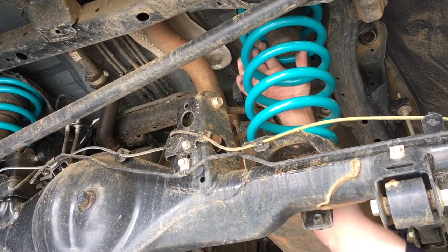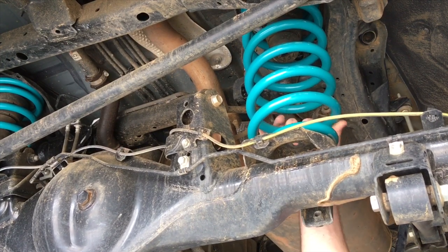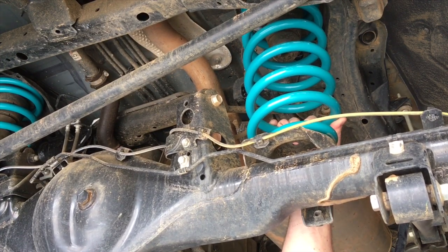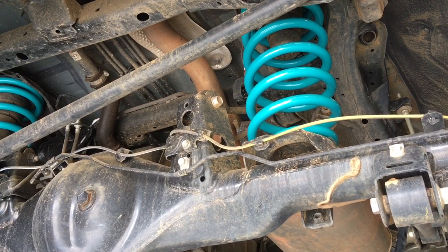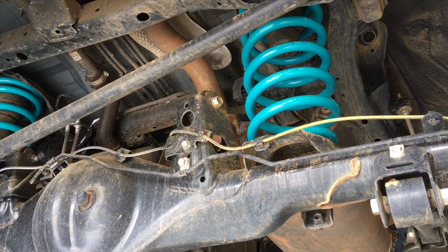Just make sure that your top hats are sitting in properly, and when you do finally push it up, that your springs and your top outs and everything are sitting in the right spot at the top there. They just sort of got to centrally locate, if you know what I mean. So now we're going to jack it up slowly,